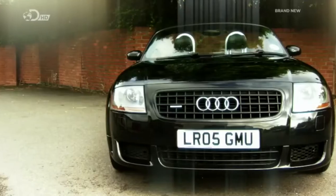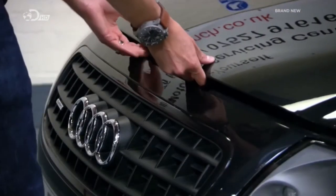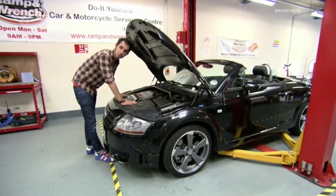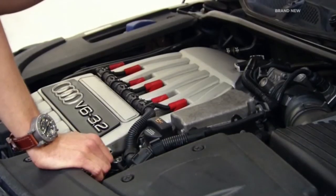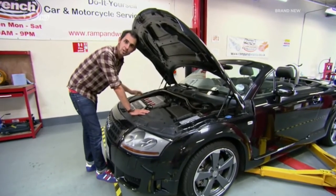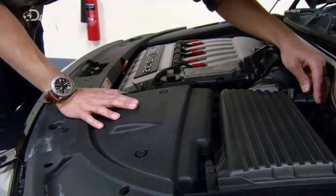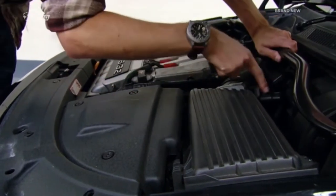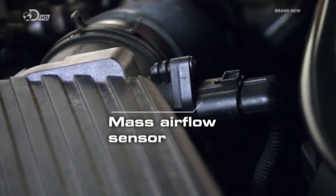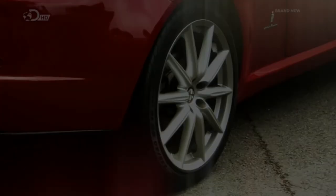As it shares parts with the Golf, the TT is cheap to maintain, but there are some things to check for. Audi water pumps have plastic impellers and were known to fail and cause engine damage to the tune of two and a half grand. So if you're looking at a car which doesn't have a receipt to prove that a replacement water pump was fitted, you're better off getting one done for peace of mind — that'll cost you about £190. Flat spots in performance could be the mass airflow sensor causing problems. If you unplug it and the flat spot disappears, you'll need a new one for £70. The TT is one of the best value drop tops on sale.